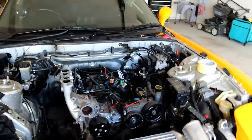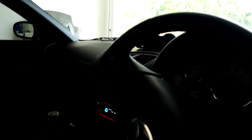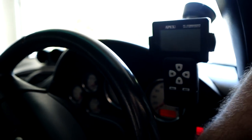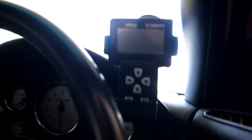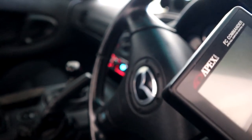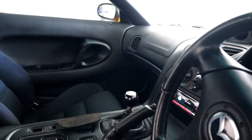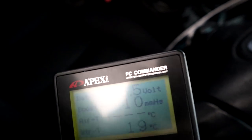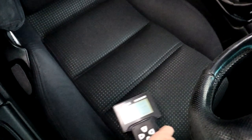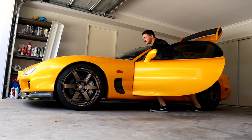As long as we are holding the fuel pressure that's in there and we get a lower intake manifold gasket, we can effectively just bolt all that on today. But first, I had a quick chat to Ben and he said, at the moment when the car is off it doesn't do anything, and when I turn it on we get power but we don't get fuel pump. Checking over the readout - battery voltage is at 6.5. We must have been draining some power somewhere.